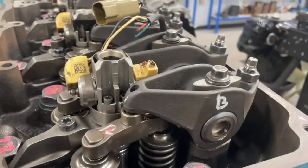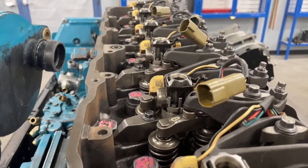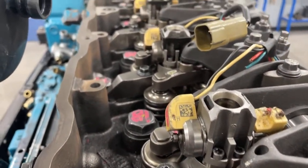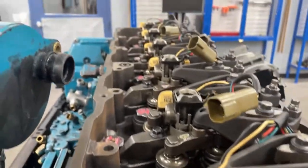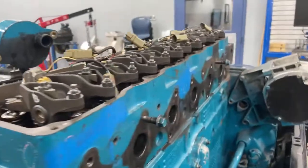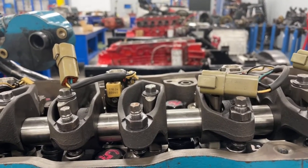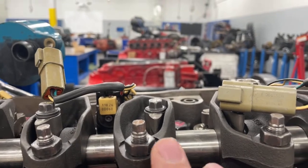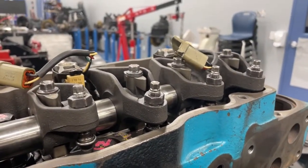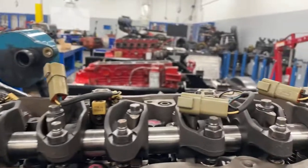Always double-check after you've tightened the lock nut because sometimes tightening the nut turns the adjusting screw. Also, before you put the valve cover back on, check the head area and make sure you've gotten all tools and parts out of it — think about what one little ratchet could do inside there if you left it in. Always double-check for tools before finishing up. One thing you should see is that we're only compensating for a few thousandths of an inch of wear, so if you see a huge difference in threads showing from one adjusting screw to the next, that's an indicator something is wrong — possibly an improper adjustment or a bent push rod.